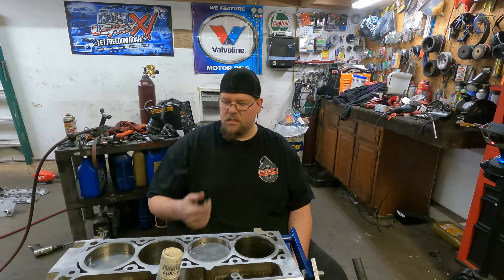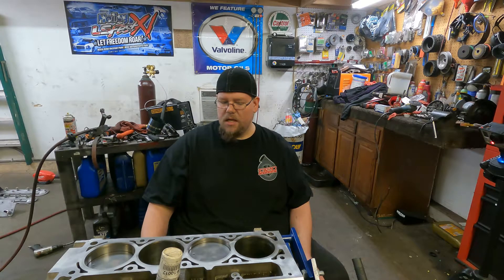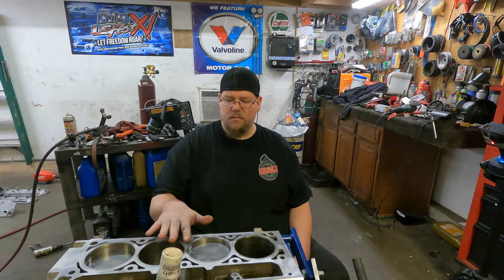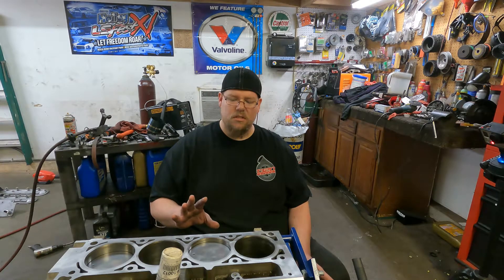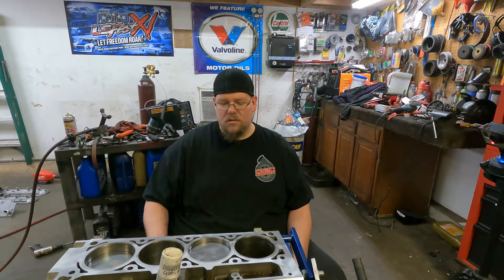That's one thing that'll make things a lot easier. As I assembled this engine, I already had all the rings and bearings placed into the rods and pistons. I started on the odd side — on GM that's the driver side — so you go 1, 3, 5, 7. I just kept that side up and every time I wanted to put a new piston in I'd rotate the crankshaft, center up the bearing journal, tap the piston in, and put the cap on. None of them are torqued yet, but the cap is screwed on with my cordless ratchet.